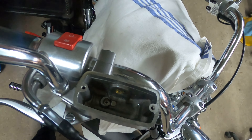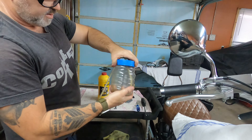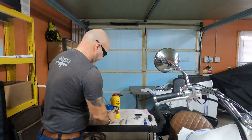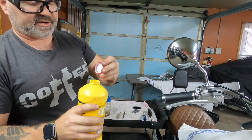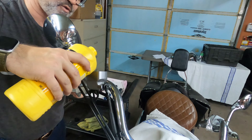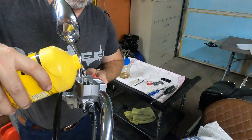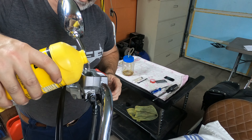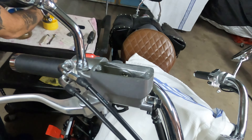Open the bottle and put a little bit of fluid from here to here. We want to lift the diaphragm nice and slow. Have a quick look at the fluid in here — that fluid needs to be changed; it's actually pretty black. So now we're going to use the syringe and suck up the fluid as much as we possibly can, then put it in our container.